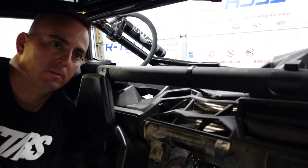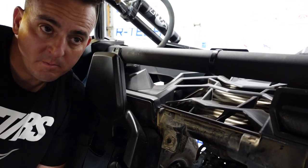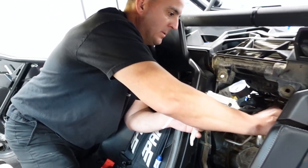If that's the setting for this tune, I need to check. We'll check on the map tuner. I'm going to go grab the map tuner and bring it in. We'll have to actually look at the settings, what this thing should be. And we're going to run to the hardware store. We're going to rig up some stuff. We're going to make a boost — a way to introduce pressure into the turbo system and charge tubes. We're going to check for leaks. It looks like we have the right wastegate actuator and we're at least close on that crack pressure.